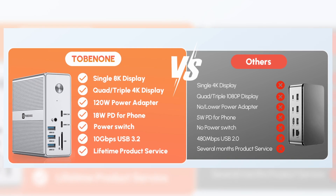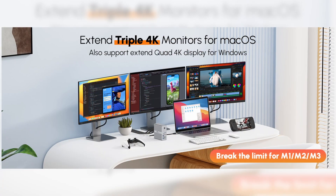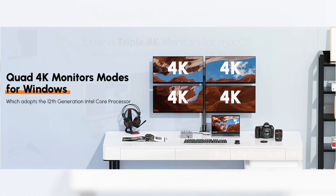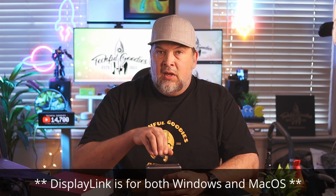One of the other cool things about this in particular, which makes it fairly unique, is that you can have one single 8K display coming out of here. With 8K becoming a bit more popular, you can actually use this to display 8K out of the HDMI 3 or DP3 port. If you're going to use 4K or below, you can use triple display mode for macOS, and you can also use quad display mode for Windows, because it does use a DisplayLink driver — so that's the driver you'll download to use four monitors.